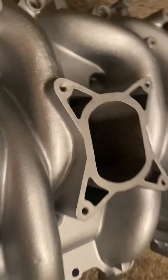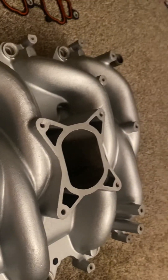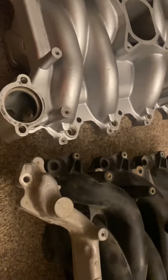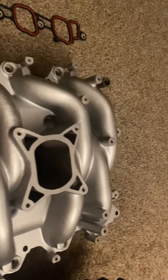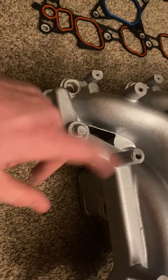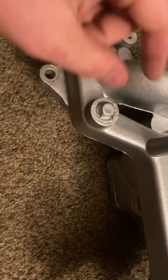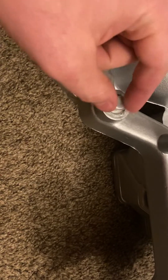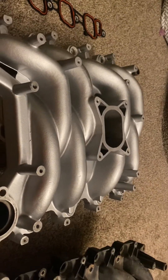A couple of things to notice: where the plenum would mount, there's no gasket o-ring like the factory one has — this one does not have one. All your fuel injectors are in the exact same location as on the stock intake, and all the same bolt holes are in the exact same spots. Pretty much the Typhoon intake is a direct bolt-on — all the hardware will bolt up to the same place. If your car does not have a coolant temperature sensor, you will need to plug the port, but I believe it's a 3/8 NPT — I got a plug at Home Depot wrapped with Teflon tape for about two bucks.